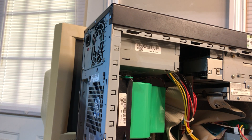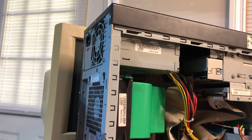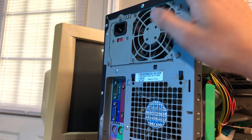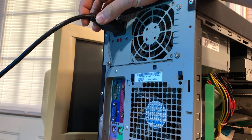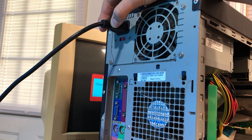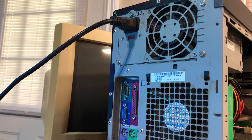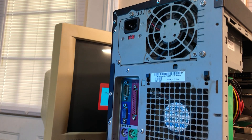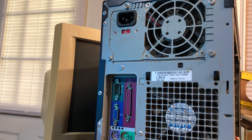Today we've got this Dell Dimension 3000 in the new workshop. I've set up a new little workshop area. I'm going to show you an interesting thing that happens with this. The system works, but let me plug it in. You can see the other fan goes but the power supply fan is stuck. I'll try to fix that eventually, but for now, just so I can use the computer, I have an old power supply on hand that we're going to switch into the system.